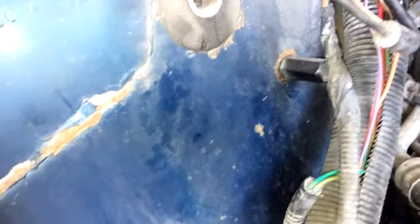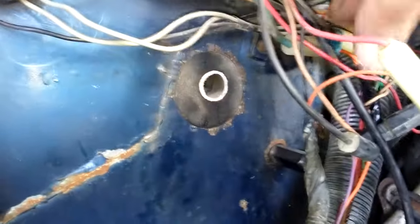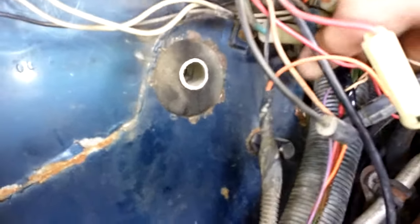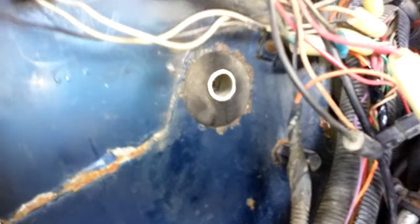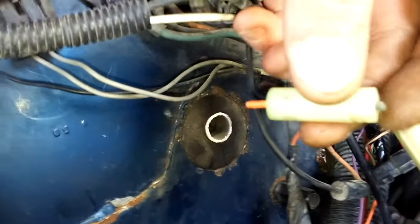What I came up with is that the factory put in these little splices here. You can see them — they go from different colors. There's a couple splices down in here, another one down here. I checked those and then just took my tester. This is your power rail right here. Come to find out it was this black wire leading to the orange wire, which I believe goes back to your computer and sends power to your relay. There's power coming off this block.